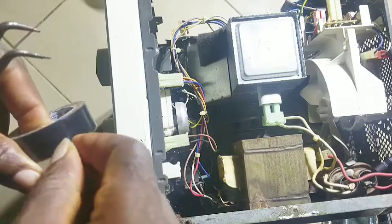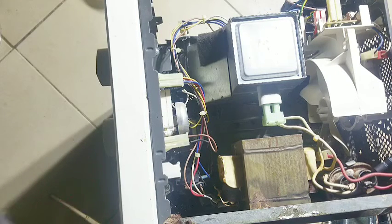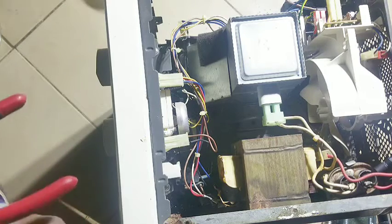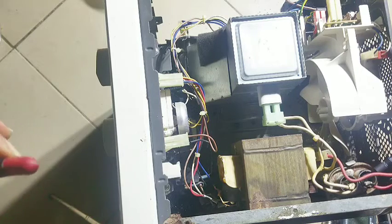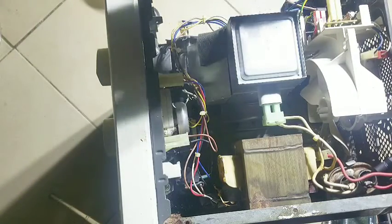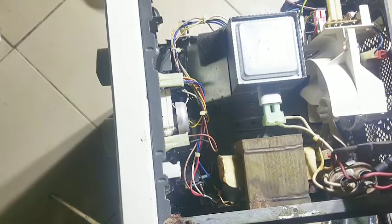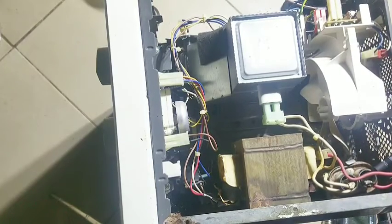The first phase of this test I'm gonna perform here is the transformer test — see what happens if we plug it to light. We're gonna test a lot of things: the magnetron, and the capacitor. Before touching this you have to discharge it. Even before this moment, the fuse that you can see over here has been blown and we just rewired it.